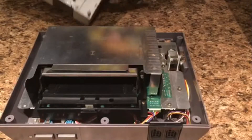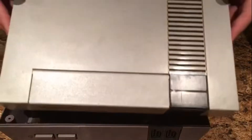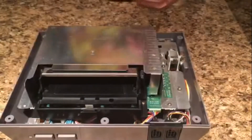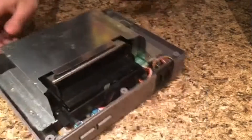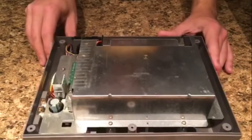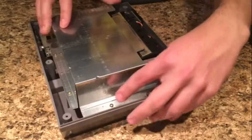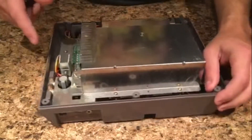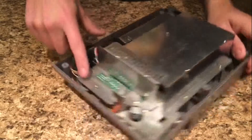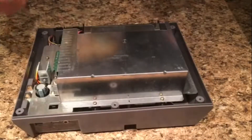I'm going to set this aside — obviously it's washable. Now you can turn it over and your lid should come off really easily. It's not that bad on the inside, to be totally honest. The exterior was really gross. This lid is all just one piece and it's washable by itself — I'm not going to take it apart any further because honestly I can't. So I'm going to set that aside, and now we're inside the console itself. Going around this piece of RF shielding, which is just the top piece of metal, there are seven screws total — including one behind the little heat sink. Go ahead and remove all seven of those screws.